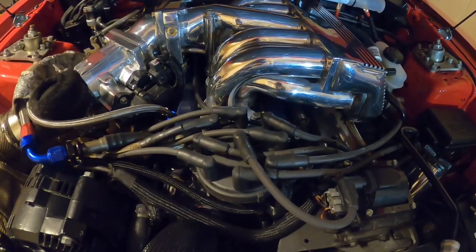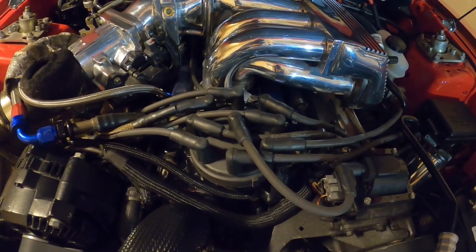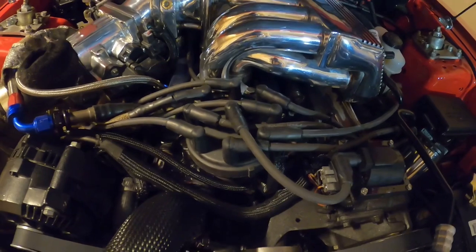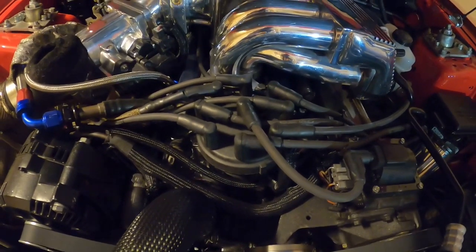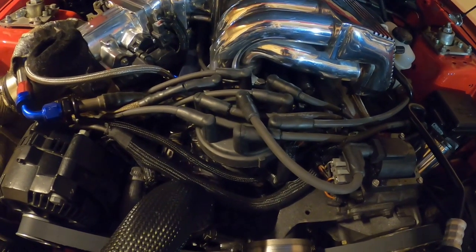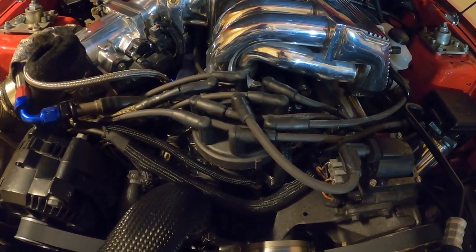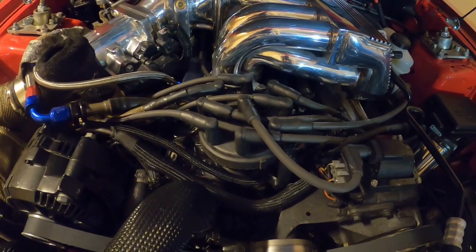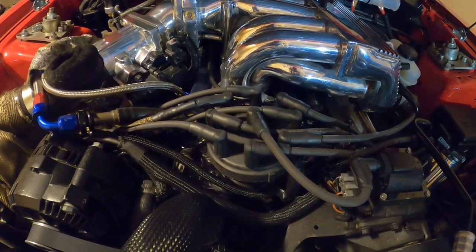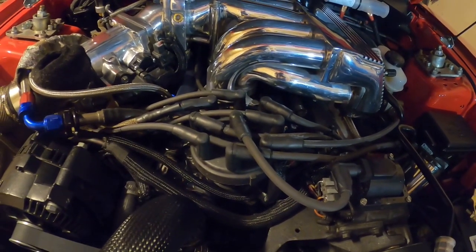Also, you're going to have to get a couple of things, either secondhand or from one of the catalog stores. Like I said, if you're good on Marketplace, you can find this stuff with a little patience. Things like a camshaft. The camshaft is important to the combination. You don't want the wrong camshaft for this combination we're trying to put together. Things like headers, mufflers, X-pipe, little stuff like that will free up airflow or give you a restriction in airflow, which can make a big difference in trying to make 300 rear horsepower.